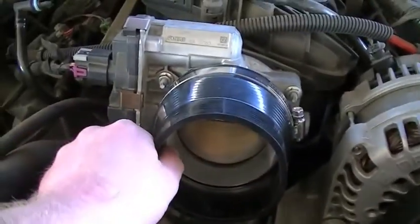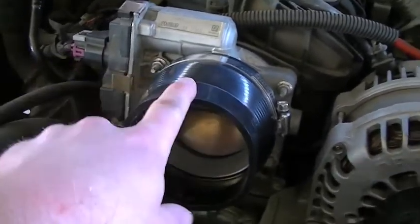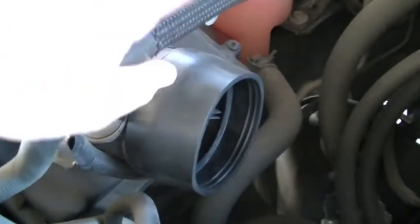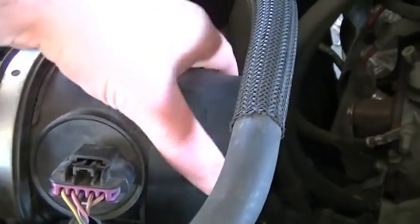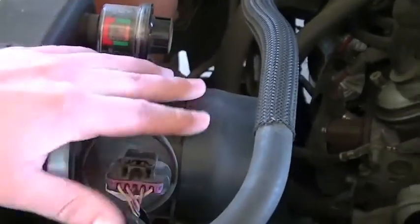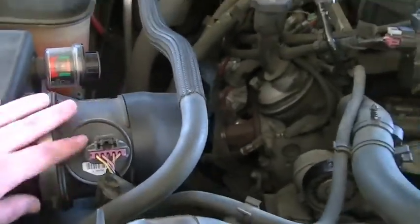I've already got the factory intake tube removed, and I've got a reducer right here — this is 4-inch down to 3.5-inch. Over here on the mass airflow sensor body, I've got a coupler which is really 3.5 to 3.5. This is a bit of a snug fit. This mass airflow body does measure out to 3.5-inch, so it is a snug fit, which is good — it means it's airtight. You just kind of got to muscle it on there. I thought I would need some heat to stretch it out a little bit, but I didn't. I got it on there just fine.